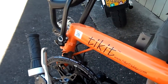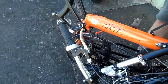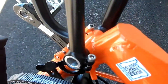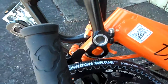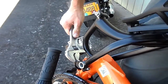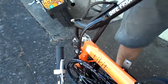Second possible interference position: here we are in the latch position — the bike is folded. In order to pack this into a suitcase, you have to go into what we call the overfold position, so the sweeper lifts it off. Rather than putting it back in the riding position, I lift it off and actually fold it slightly farther. The latch peg is no longer in the latch plate's hole — it's actually folding the bike just a little bit farther. If the back end of the sweeper were up about five centimeters higher, you can imagine I'd get stuck, captured in between the stop and the latch plate.